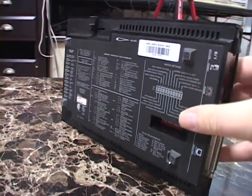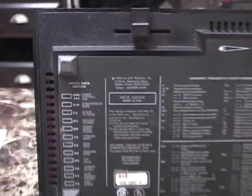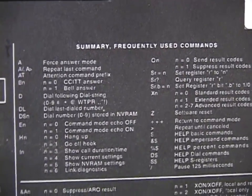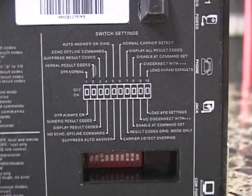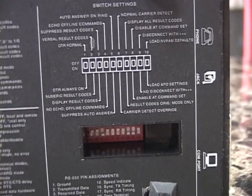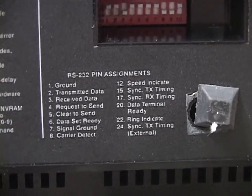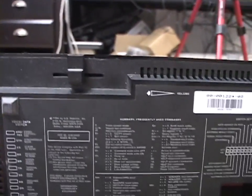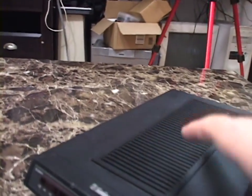There's also a power switch. If you look at the bottom, U.S. Robotics did a very cool thing by putting explanations for all the LEDs, a summary of the most useful commands, a set of DIP switches to configure more things on the modem, and it tells you what each pin of the RS-232 serial port does. And you get a slider volume control because this modem has a built-in speaker.